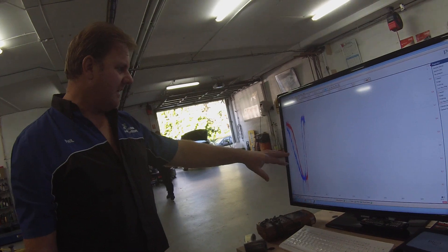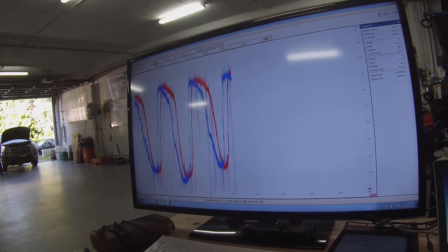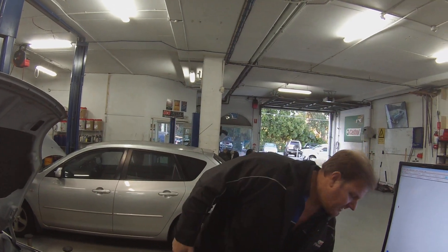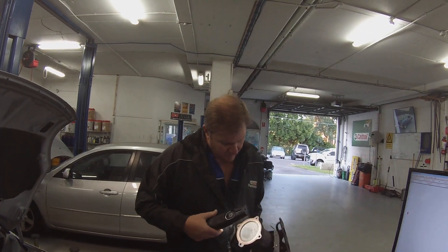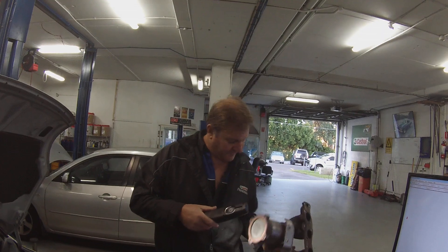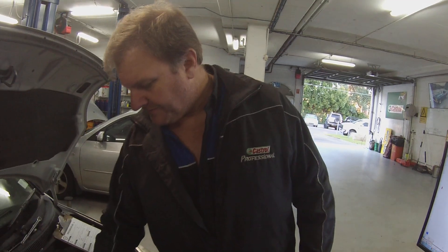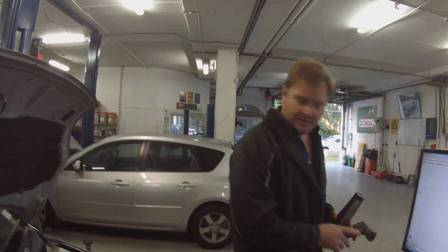It's a very clear result. We've actually got to work out how to filter these little lines out and get more of a direct line. So we've fitted the new manifold — the exhaust manifold with the catalytic converter in it. It doesn't appear to be anything physically wrong with this catalytic converter, it all looks in fine condition to the eye. But as you saw with the waveform patterns it wasn't working. We've just fitted it and quickly run it — it's still cold, on about 60 degrees.